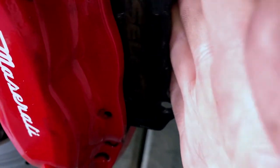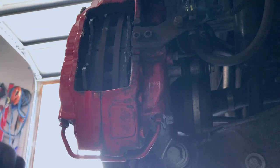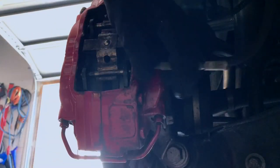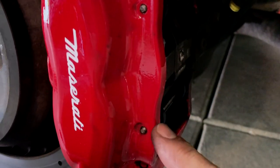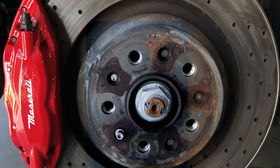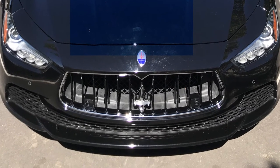Insert the new pads, making sure they are facing the right direction — you don't want the lubed part to touch the rotors. Time to reassemble: lube the pins and insert the first pin with the shim. I use the nail set to hammer both pins into place. Check the depth of the pins on the front side of the caliper — that looks good. Do this on the other side and you're all done. I hope this helps you out and saves you some cash at the same time. Thanks for watching. Peace.